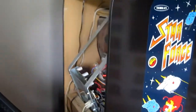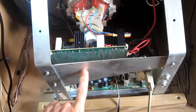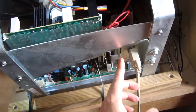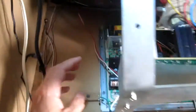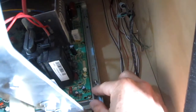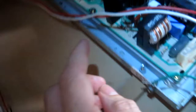Here's the monitor in the back of the cabinet. It was a pain to get this thing out of here. Got to remove this metal thing — there's some screws right there. Got to remove these two bolts and the VGA board. Then remove these four bolts: one here, one here, one here, and one here. There's a metal subframe that's connected to the circuit board, and you kind of lift it up and spin it so you can get access to the screws.